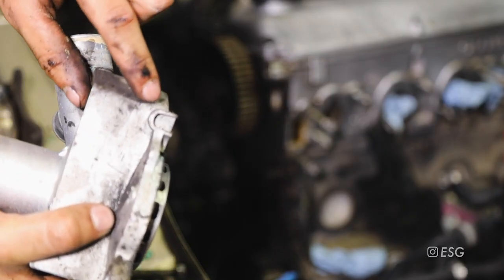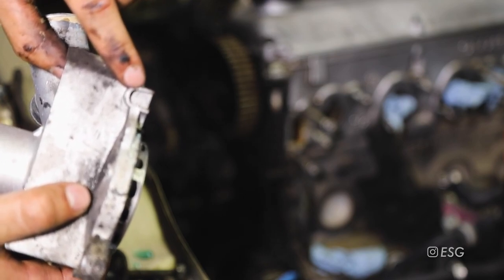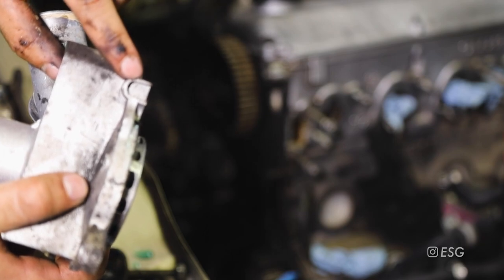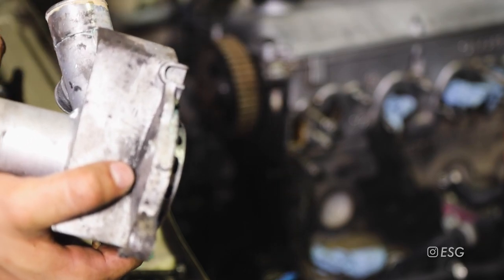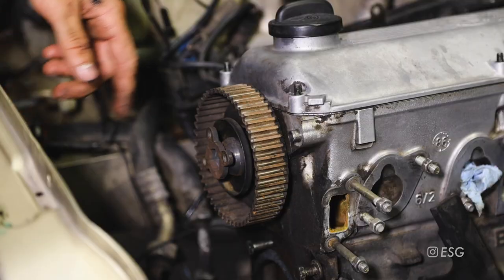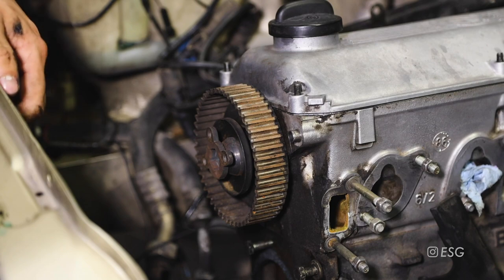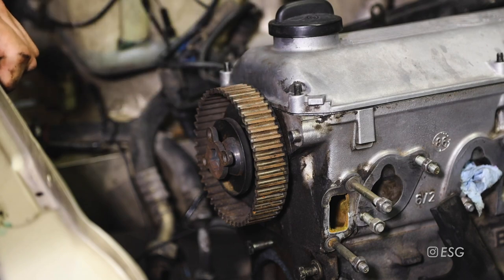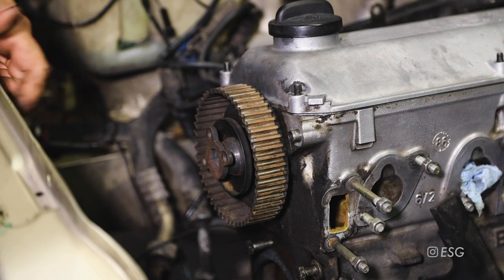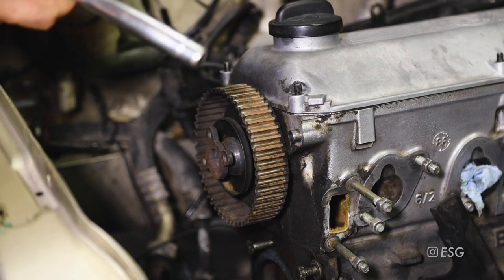On this side of the water pump there's a little U shape - this is actually where the spring and guide pin are supposed to sit that come from the tensioner. I didn't have mine but I'm going to place an order tonight and get that guide pin and spring and put it on. Now I'm going to get to the camshaft seal - it's behind the camshaft sprocket so we have to take it off. Mine's an 8 millimeter allen; if you're doing it on a later model E30 I believe it's an E14 reverse torx.